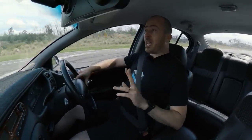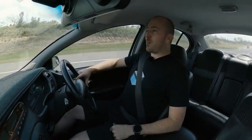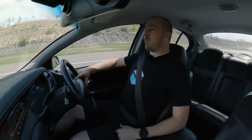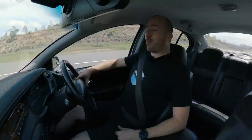And best of all, we have separated those two fluids which are incompatible with each other. So I wasn't really happy with them being in such close proximity. And as I mentioned, it can put you up for a gearbox rebuild if it all goes wrong. So a transcooler is really a good piece of insurance to future-proof your car and hopefully avoid that massive expense.